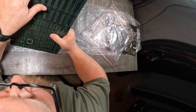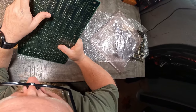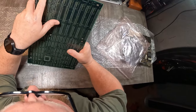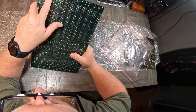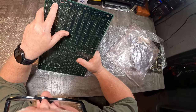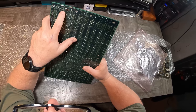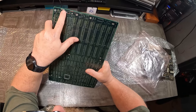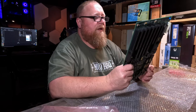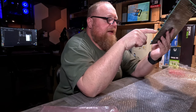Look, there's more — here's two more, and a lot of flux going on here. Strangely though, the back of the board does not look that bad, but I definitely see signs of corrosion here. These five pins here are where the keyboard connector would have gone, and there's a lot of corrosion there. These two right here are where the battery would have gone. And then these two here would be where the keyboard just mounts for rigidity. All of the problems are contained to this area right here.